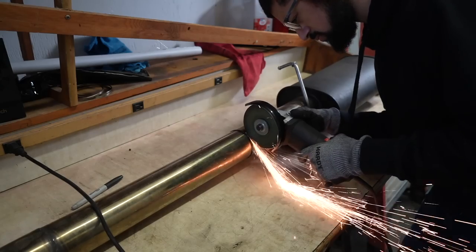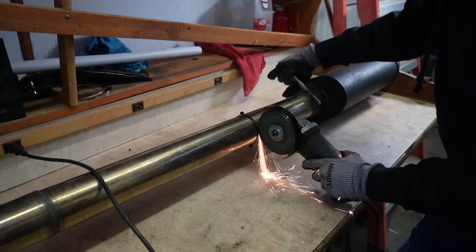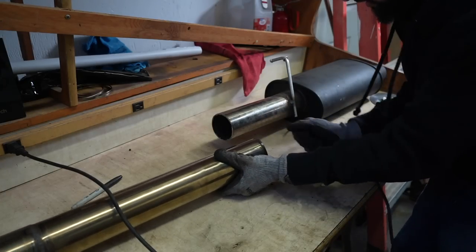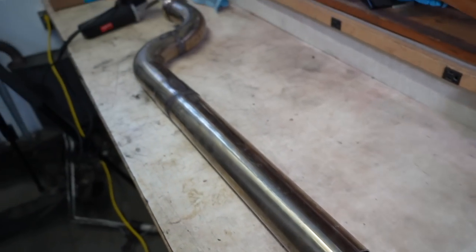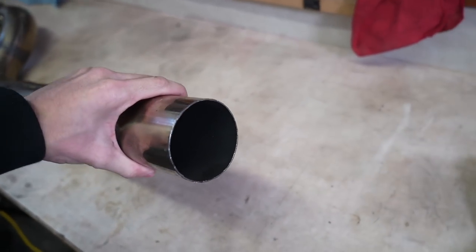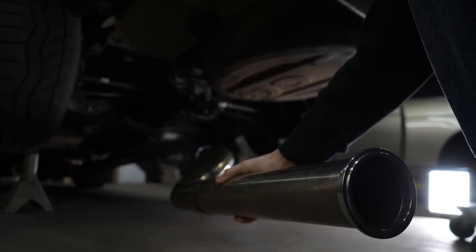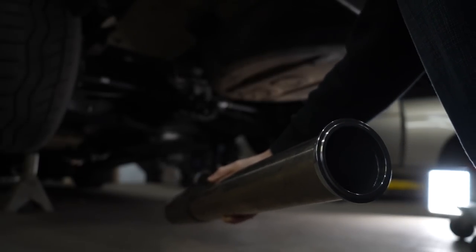I've never cut a line so straight before with just an angle grinder - look at how straight it's going so far. The zip tie is so clutch. Now that this pipe is all filed off, clean, and cut down, I can install it and get the v-band just tacked in with the MIG welder, since I don't have a TIG welder. I'm gonna have to bring this pipe to my dad's welding shop, use his TIG welder, bring it back, and hope and pray that it fits and works. I got the non-welded v-band on - hopefully it's gonna be lining up straight and I can just weld it on.